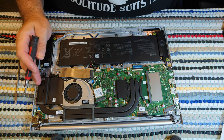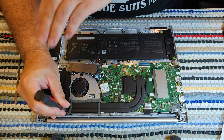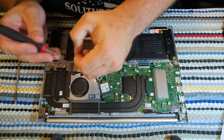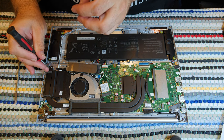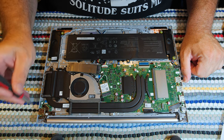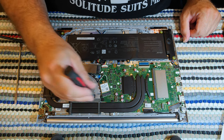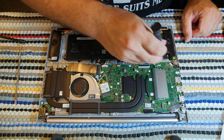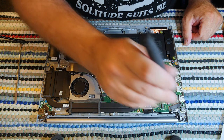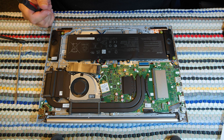Get that back down. Okay. That's good. There was a black screw that went right here, and there's a silver one that goes here. While I'm in here, I already checked these hinge screws. Just real quick, it doesn't hurt to check a few more. This looks like a duct for the fan. It's not a bad idea to just poke every screw with a screwdriver just to see what happens, see if it feels loose. Don't over-tighten the ones on the battery plastic, but I just want to make sure that everything is tight enough.